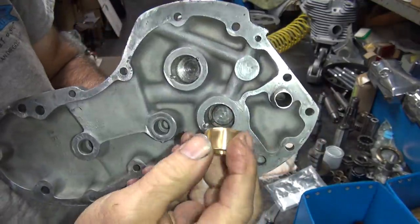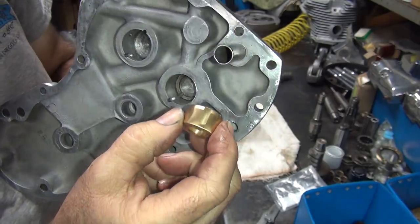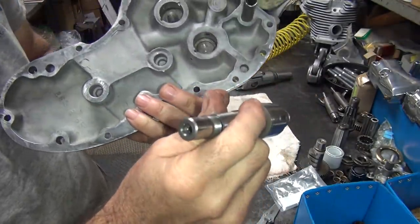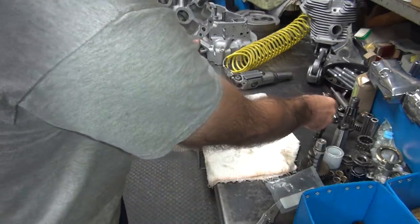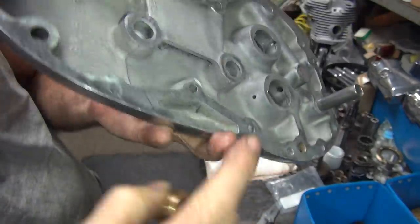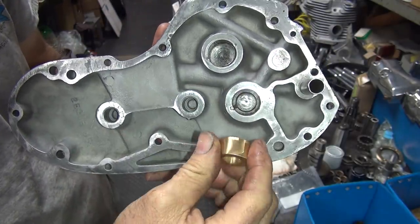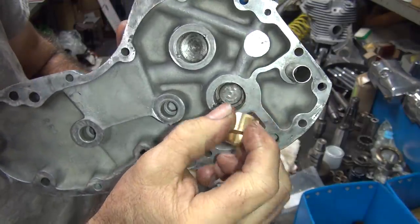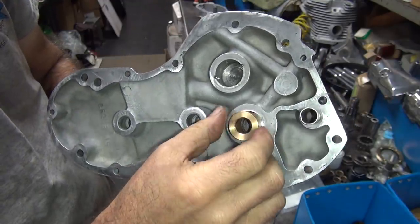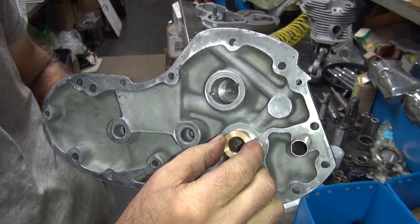If you want to use the end oiler groove, you have a couple things that happen. One is you have very low oil pressure, because now you are completely lubricating the end of the crank the whole time, and these early pumps don't regulate oil. So you wind up having basically zero oil at your top end. The next problem is that hole right there is purposely in there to keep any oil that gets on the back side to get it out. So that just puts a direct oil path there and it blows right out. If you're going to make it an end oiler, you have to plug this hole up — but if you do that, you probably have no oil pressure at the top end.